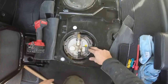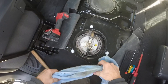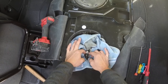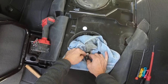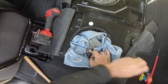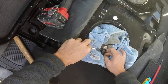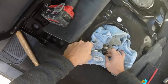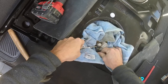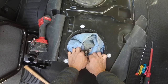Next thing you'll need to do is press this clip down and push that back. Now relieving fuel — it's going to be under pressure still — so wrap a nice rag around this thing. What I'm going to disconnect is this fuel line connector. You just push those two clips in. It might need a small screwdriver to help you with the unclipping. Now it's unclicked — take your rag and gently start relieving the pressure.